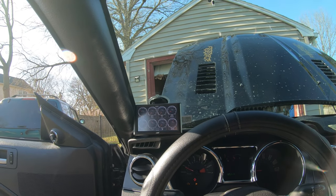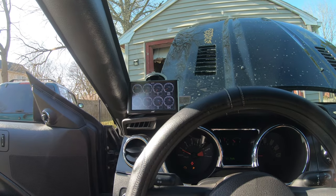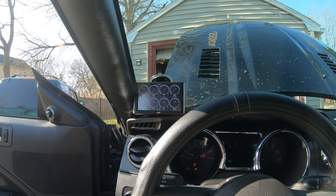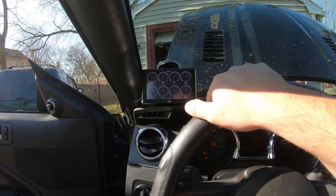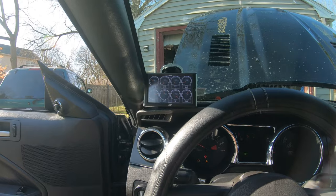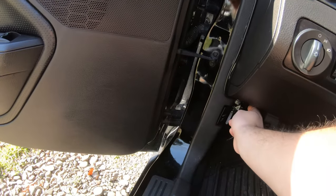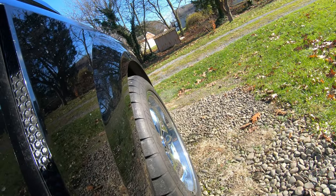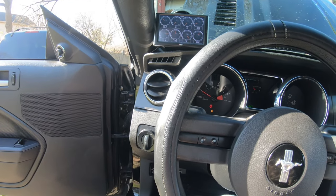It's still only 104 degrees ECT, so once that gets up to around 125–135 the RPMs will be lower, and once it gets up to 180 it should get the full chop. We'll just let it idle a little bit. Let's go ahead and turn this open and listen. Just like that, idle chop is gone.